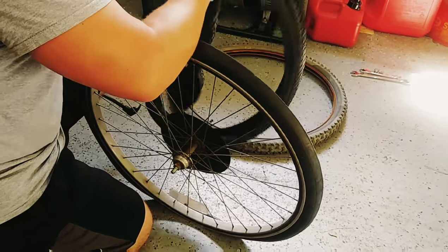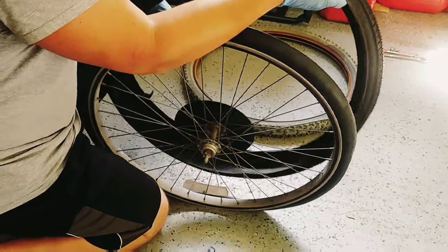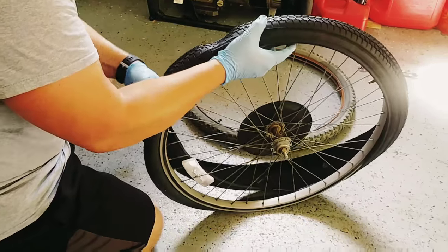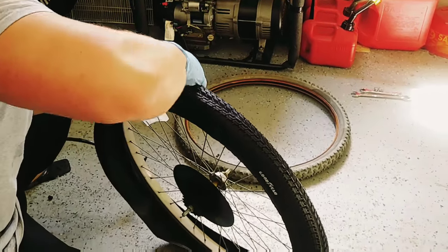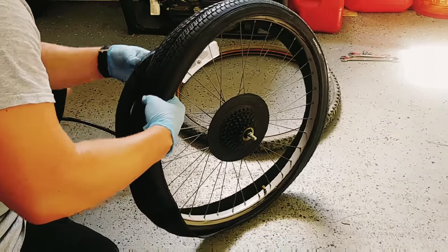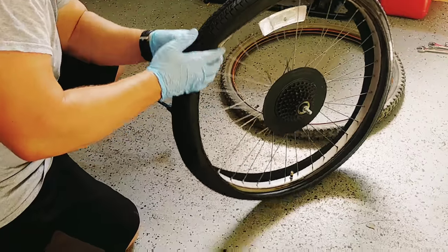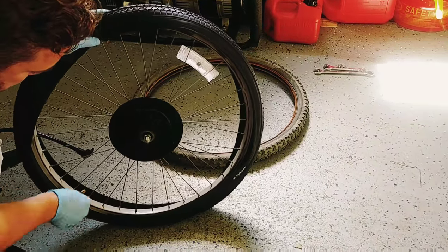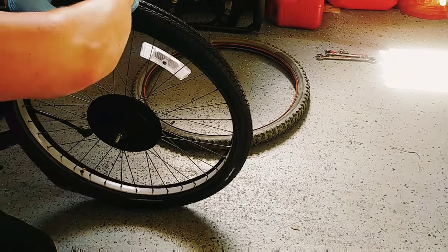Right here we want it real nice and perpendicular to the rim. This is the last step - it takes a little bit of shaping on the tire itself. Once we get it around, we'll go ahead and fit this, and it takes a little bit of finagling. We just have to maneuver the new tire over, and if you've put too much air into that inner tube then this is going to make it a little bit more difficult. At this point I've just about got it over the entire rim. We've got the valve through the rim keeping it straight - we do not want that at an angle or pinched. We've got just a little bit of air in the inner tube and now it's time to start.